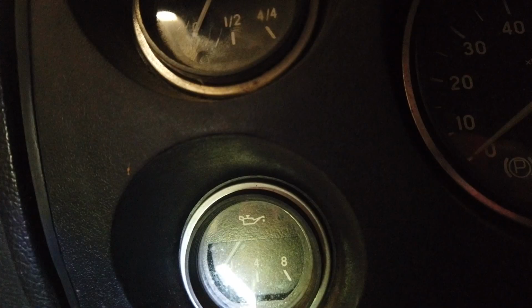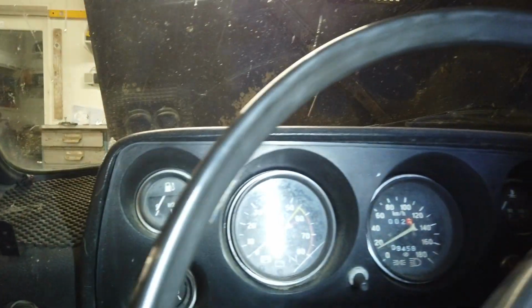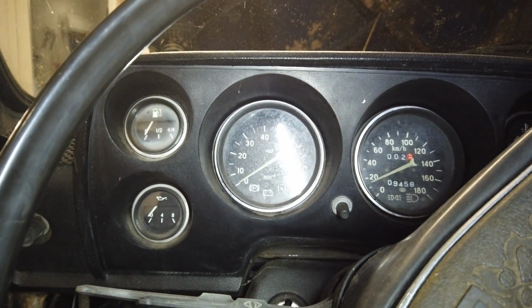But as you can see right here, the oil pressure gauge reached 0. When I put the ignition on, hey, the light is back on. It wasn't before. Some things are not working properly just yet. But when I fire it up, it shuts off, but it doesn't read anything. So I think in the next video I will be checking the engine health out a little bit and making sure that it actually got oil pressure, because that's important.